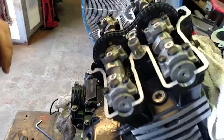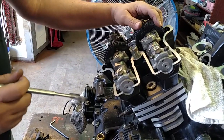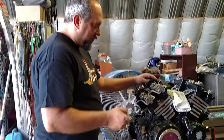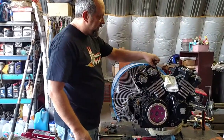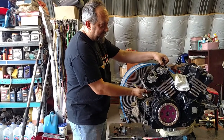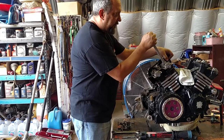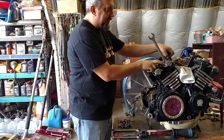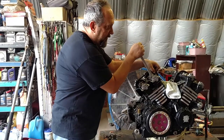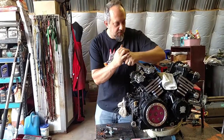What the manual says to do is to leave the sprockets loose, align the cam, put your bolts in the sprockets, and tighten them up. I don't like that method just because it takes a little longer and you've got to unbolt the sprockets off the camshaft. So what I like to do is go ahead and make sure that I've got my cams loosely installed. I'm going to pull the tension on this chain, get the chain nice and tight on the opposite side of the camshaft tensioner. I'm going to have to use two different wrenches here because right now my camshaft lobes are getting ready to start applying tension to the first set of valves, but my dot is not lined up yet. So we're going to pull some tension in this and get that dot aligned.